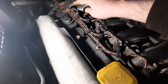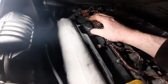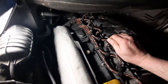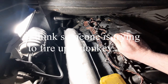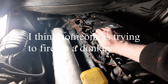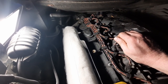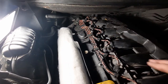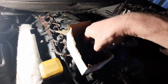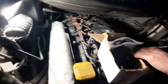So back down here, next to the main air filter lives the crankcase ventilation filter. Now, this filter apparently regularly gets overlooked during servicing, and if it blocks, it can take out the turbo pretty quickly, pressurizes the entire oil system more than it should be. So gonna get this thing out, and we have got a modified kit, which in theory should never again have to be serviced. So I get this thing out of here.